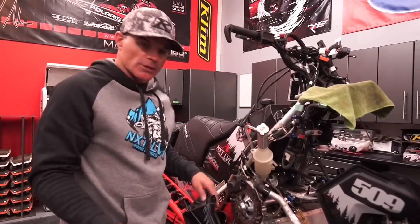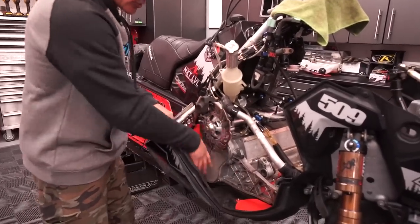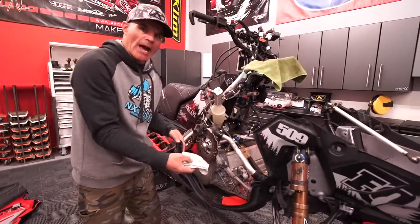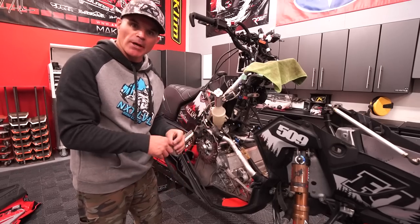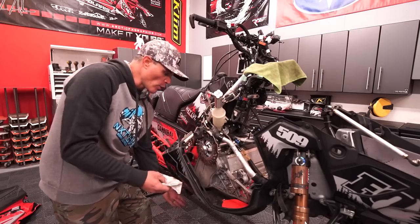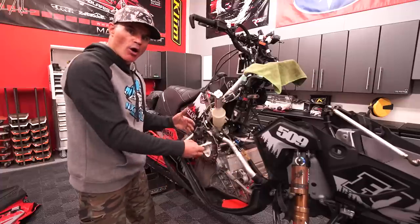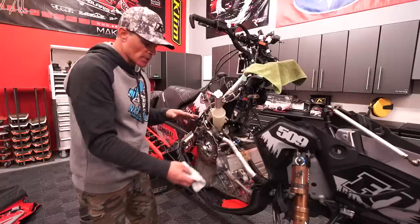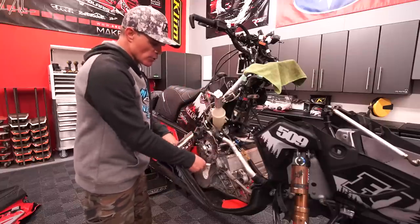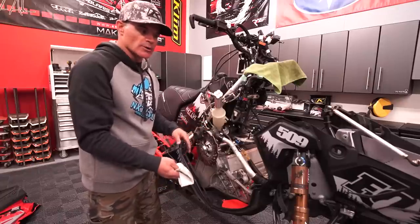For those of you with a chain case model sled, remember these no longer have a drain plug. You'll basically want to undo your chain case, pop it apart — it's a bit of a mess — but servicing your chain case is really important. We don't get to see what's happening under there, and without the old magnetic drain plug to catch metal shavings, we've got to find that out pre-season. Have an oil pan below you, let it drain, clean it, inspect the chain, top and bottom sprocket, and your tensioner, then refill. Do it pre-season and depending on mileage, we'll do ours every 500 to 700 miles.